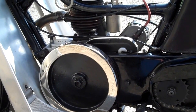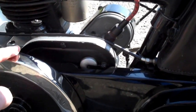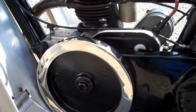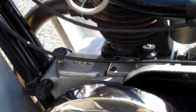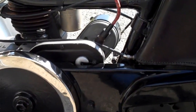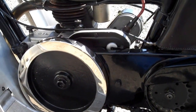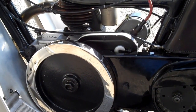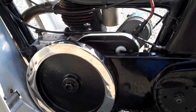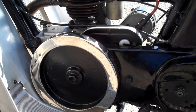The bike actually has a lot of novel features. There's the oil pump which is connected to the crankshaft. So you fill the crankcase up with oil, and when the bike's running it pumps oil through the big end, which is a long big end that runs from the flywheel right through to the other side of the engine. On the other side of the engine there's what's called an overhung crankshaft, which is connected to the piston. You can take all that piece apart on the far side — I'll show you that in a minute.